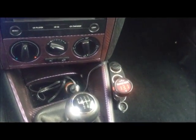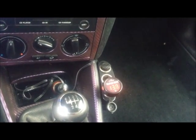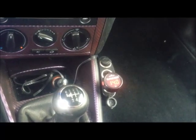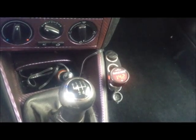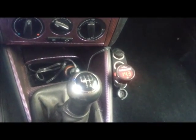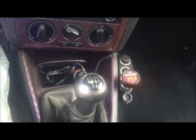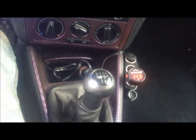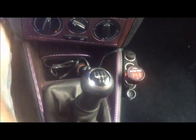You can see it's up to 13 — give a little gas, 13.5. The advantage of a capacitor bank is that they charge very quickly and can take a lot of current really fast. We're already up; the stabilization voltage is 14.4 — we're already up to 14.2, and pretty soon it'll cap out at 14.4. Although the caps don't hold a lot of energy, they can take and release small amounts of energy at a very high rate, making them ideal for starting situations.